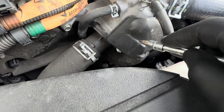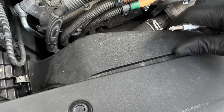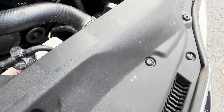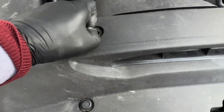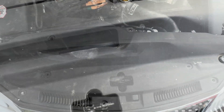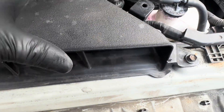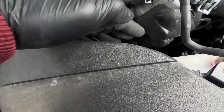I need to remove that pipe, this cover — I'll take this cover off as well — and move this little air intake scoop off. Literally just push these tabs in, all of them, then you'll be able to pop it up. Once you've pushed all the tabs, you can literally just pull them out, and then just pull that whole thing off.